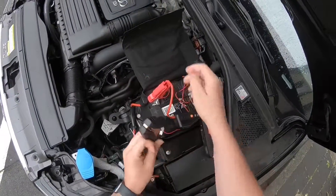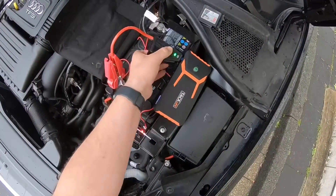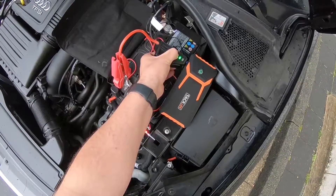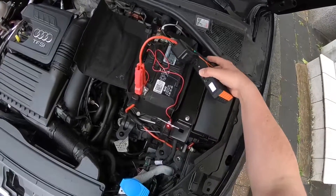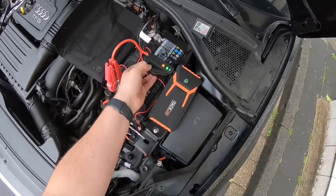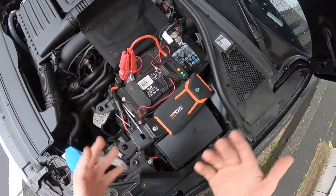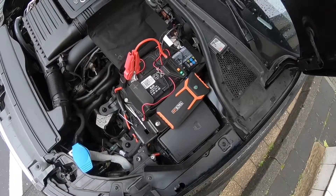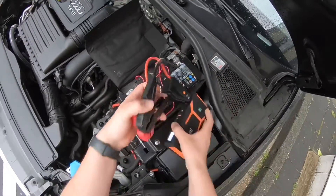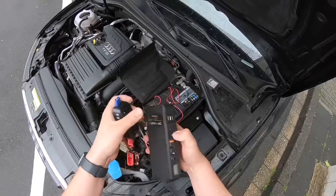Let's try this. The boost button will not work here because my battery is nearly fully charged. So: connect the clamp to plus, clamp to minus, and if there is no green LED, push the boost button. After you push the boost button, the green LED will come on — that means we are ready to start the car. The boost function is only the second step. The first step is always: turn the power on, connect with the unit, connect with the battery terminals, then start the engine — job done. If the engine doesn't start, try the boost: turn on the power switch, connect with the unit, connect with battery terminals, push the boost button, then start the car ignition. Your car will be running. Then remove everything — job done.